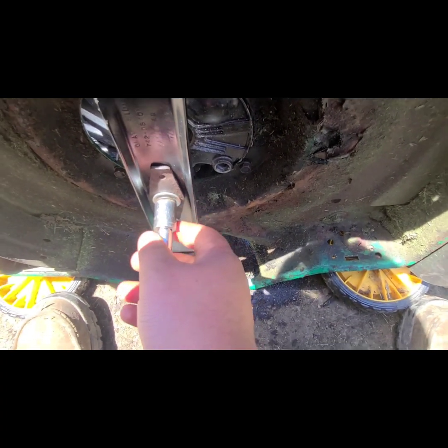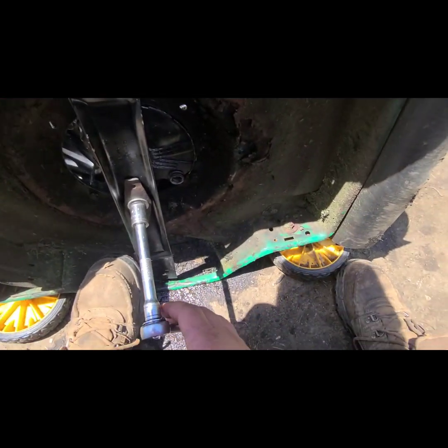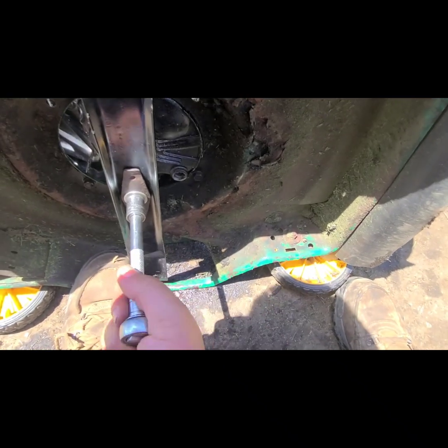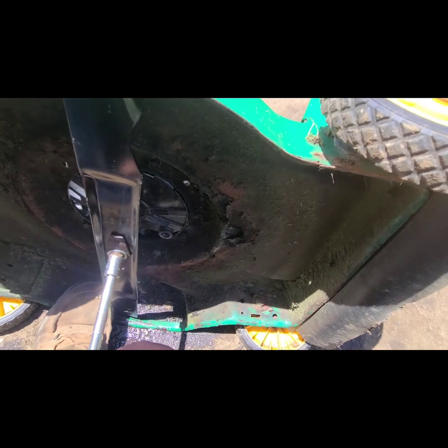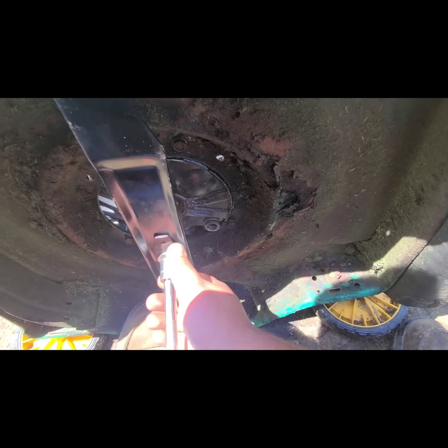I had to make this blade a little safer with this bigger adapter. Instead of this blade being halfway up the deck, it sits all the way down. This is a half-inch bolt from a Honda pressure washer pump — glad I happened to save this because we need this longer bolt to get through the thickness of the adapter and into the crank. I've got my half-inch socket ready, so here we go. I also decided to use one of those spacer washers I showed you earlier for extra stability for the blade. Make sure this blade is tight because this motor has a lot of power — this is a massive eight and a half horse engine.